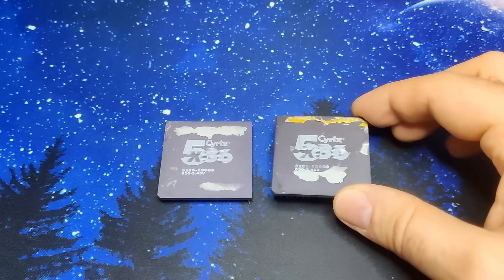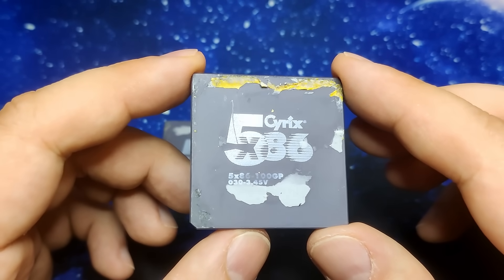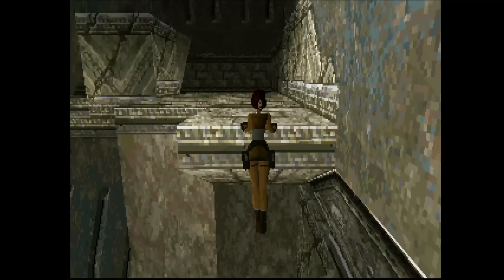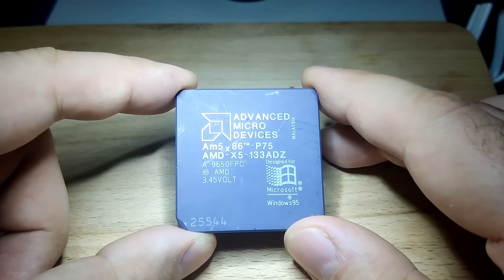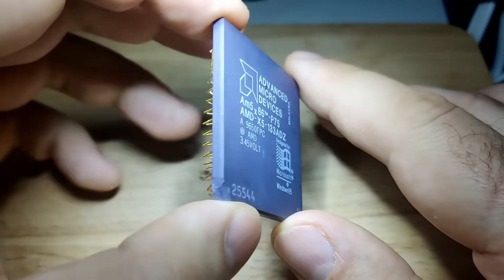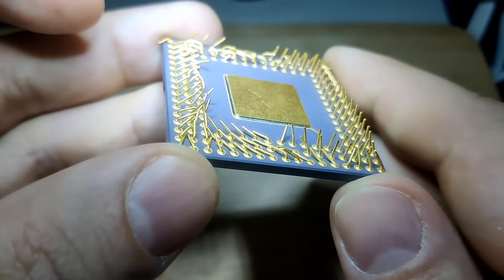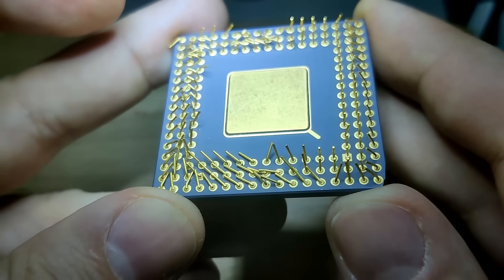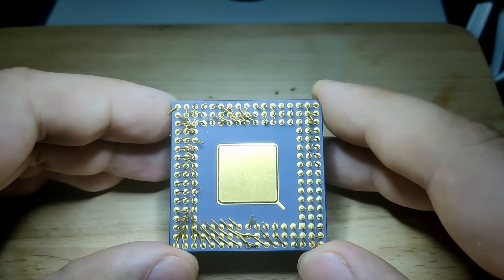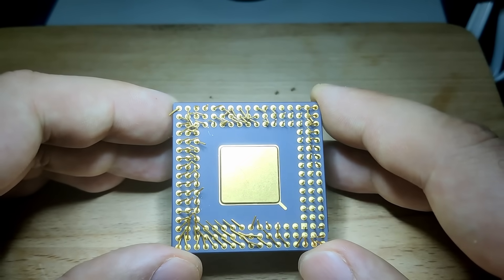So we still need something with more power. We could try to overclock the Cyrix CPU to 120MHz if the chip works at that frequency, but I doubt that this would give us the performance needed to run this game smoothly in each situation. In the next video, we are going to use the highest clocked 486 CPU I have in my collection, an AMD X5-133-ADY, provided I can restore this CPU. This CPU has the worst bent pins I have seen so far. You may have participated in the community post where I asked how many pins I will break off in an attempt to restore this CPU, and most of you said 0. I am not so sure about that, but we will find out in the next video.